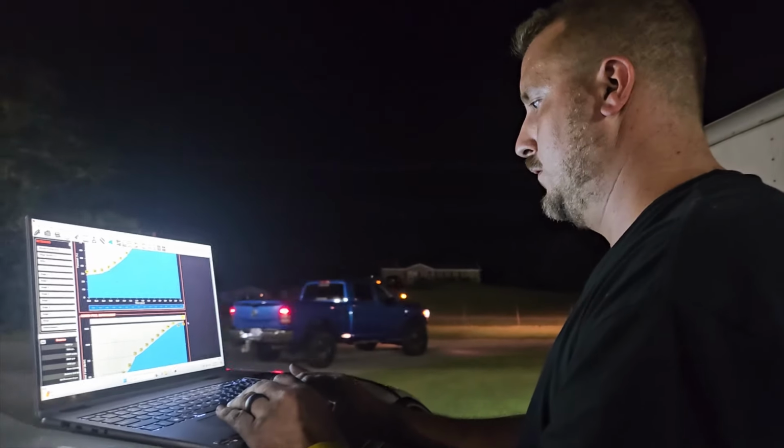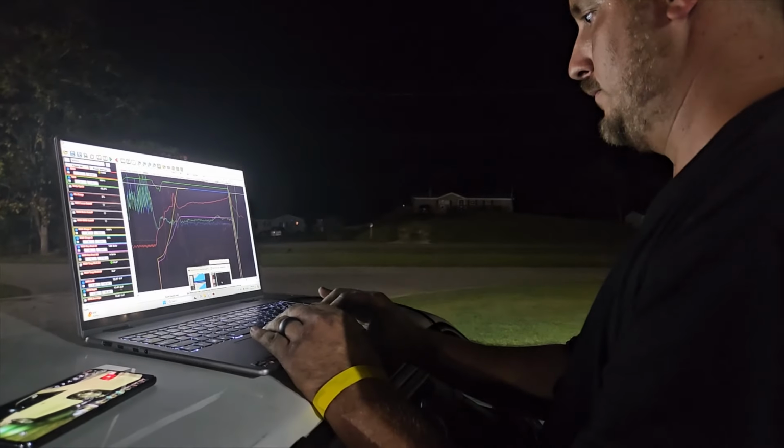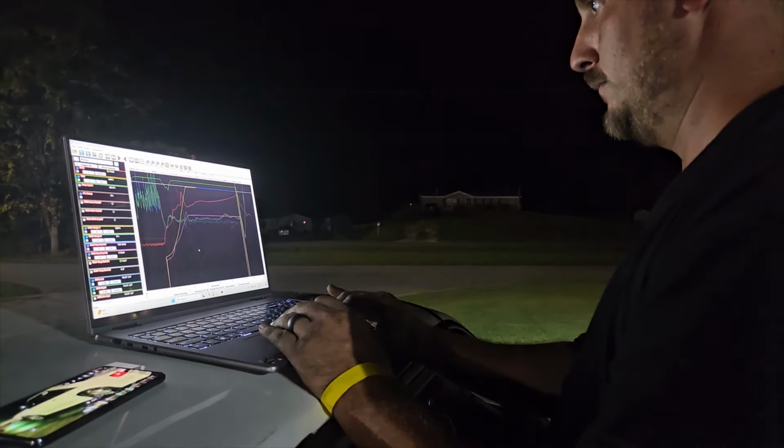So on that pass, the tire shook pretty bad, so I let out. That sucks. Oh well. Going to put another 50 pounds in the rear, leave the tire pressure what it was when we originally started, and try it again. What are we doing with the Mustang? Second gear leave, maybe both kits.